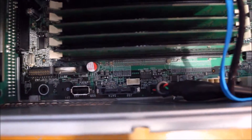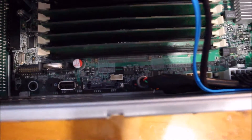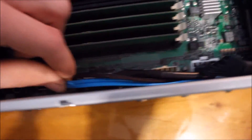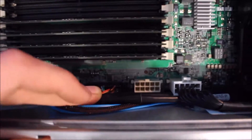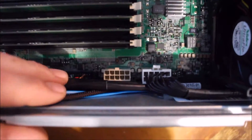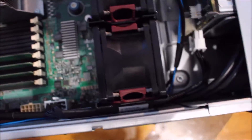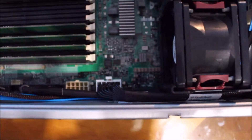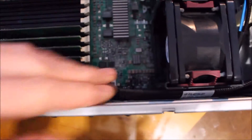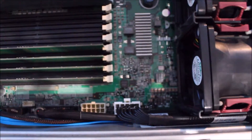You could potentially use a standard SATA cable — I'll try that and get back to you. There are also front panel indicators and two connectors for the hard drives. That will be interesting to look into for my other project — to see if I can get 5 volts to run standard 3.5-inch drives without needing extra buck converters. The motherboard also has provision for an onboard SSD card — mine isn't fitted, it's just got the pads for it, but yours might be.